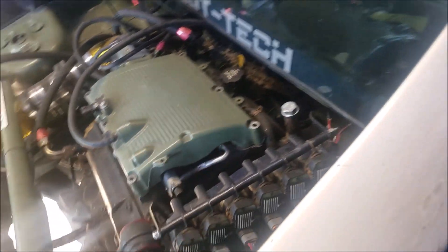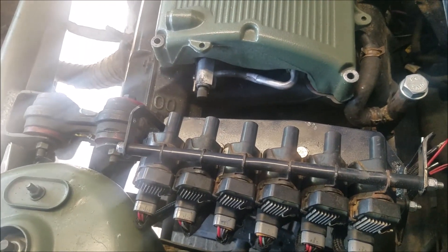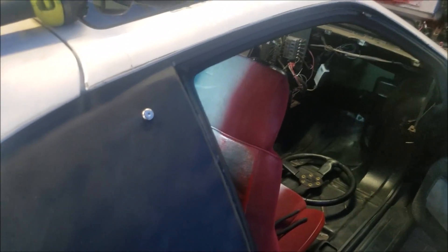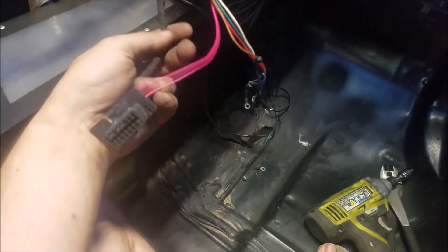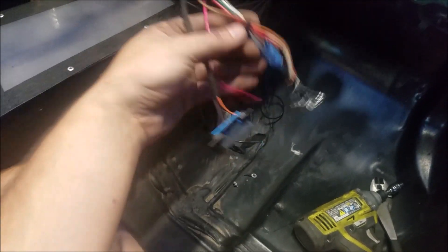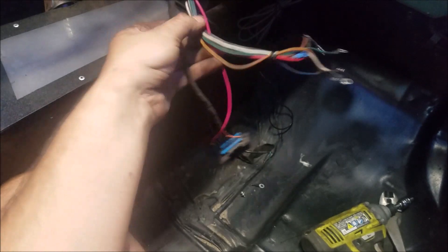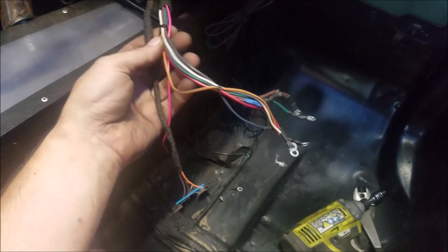Got it mounted, and naturally my dumb ass just cost myself some more money — when I had to drill the one hole it slipped and went through and gouged into the serpentine belt. So I've got to replace the serpentine belt now. We're going to go about getting these guys disconnected and pulled out. Got them unconnected — we've got the OBD2 connector and some constant powers, and then I had to cut a green trigger wire somewhere.